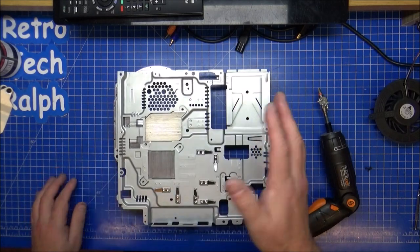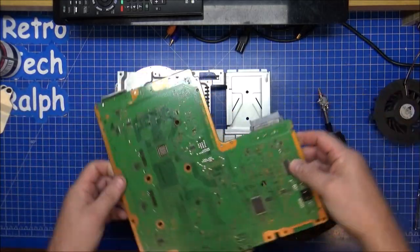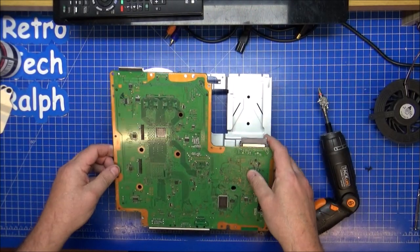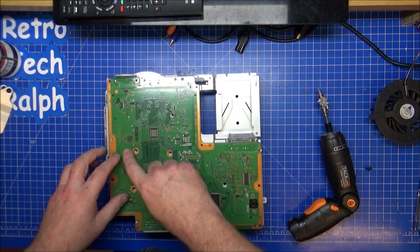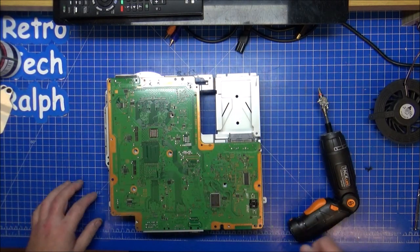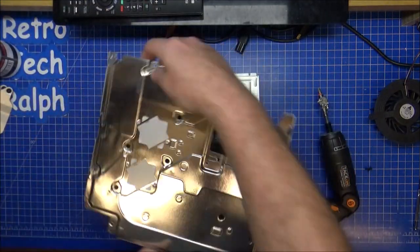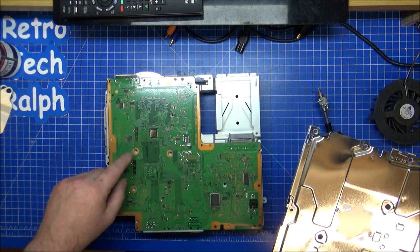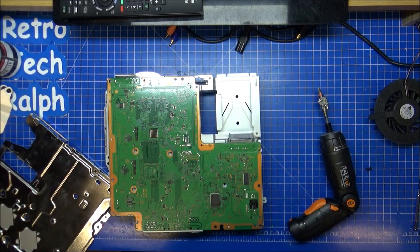So, next step will be motherboard, which only goes in one way. But you have to put it through so the connectors go in there first. And then down she goes, and squidges all the thermal paste on. Then the extra part on top, the extra shielding. Over here, that way, and screw all together. So at the minute, we just need to thermal paste the main chips and put that on. So quickly jump again, and we'll see if I've cocked up or not.